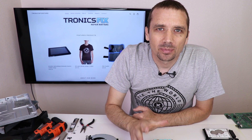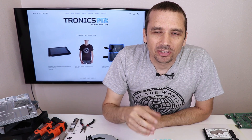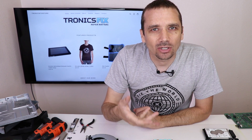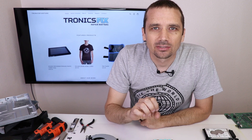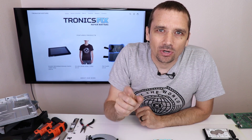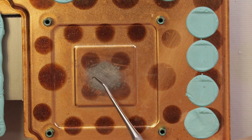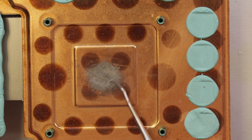By the way, don't ever scrape on your heat sink with anything metal — that'll create little tiny grooves in it. I only did it for this video to see if I could scrape off the liquid metal or if it was the heat sink. I would never do it in normal circumstances. As you saw in the microscope cam, it looks like the liquid metal may have actually integrated into the copper a little bit. It's really hard to tell, and there's just no way to get all the liquid metal out. It may have actually broken down the copper a little bit and integrated into it. You can also see there's almost like a diamond shape here where there's been more liquid metal — this must have been the main contact area.